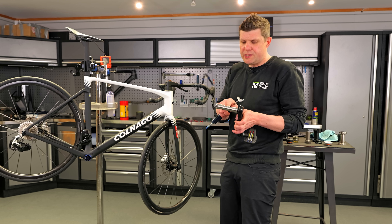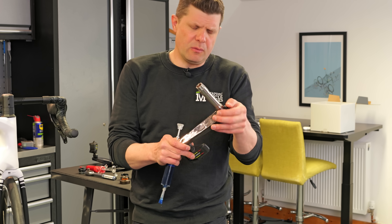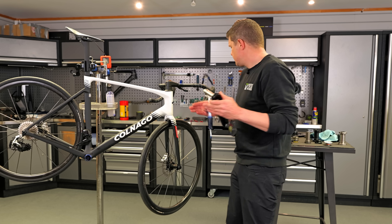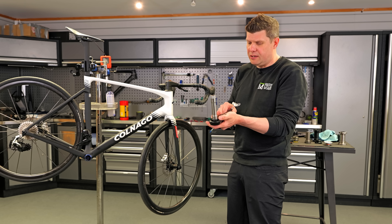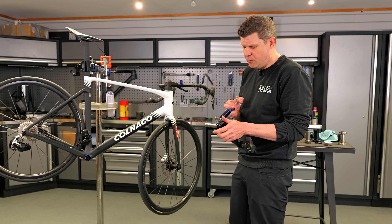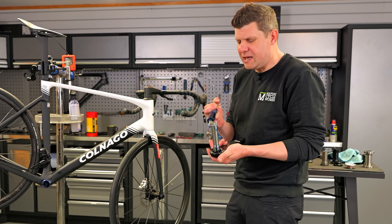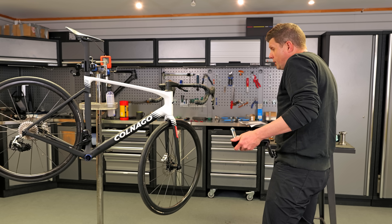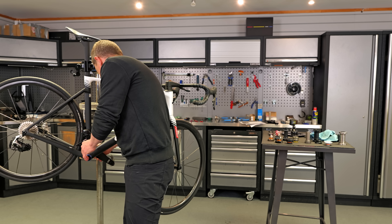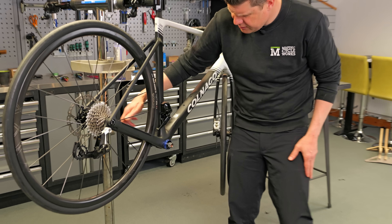One of the other issues with this Seabree crank is that it has a bearing preload on one side, like you're familiar with on SRAM cranks, and they're not particularly generous. With the Shimano Dura-Ace, I was literally at about a quarter of a turn of preload — so you haven't got a lot to play with. If the bottom bracket shell was over-specced — like it was, measuring around 68-point-something before all the facing work — it's going to be a little bit on the tight side. This should hopefully squeeze through a whole lot better now — and instantly, so much better.